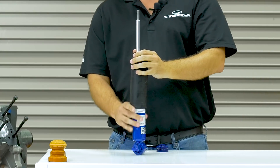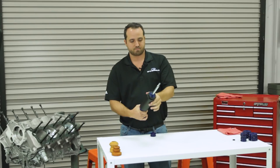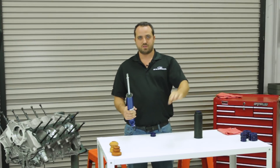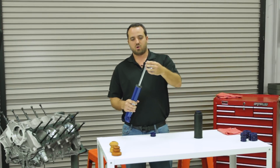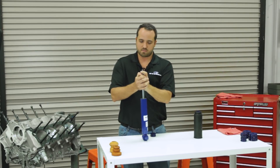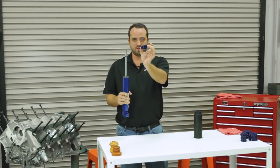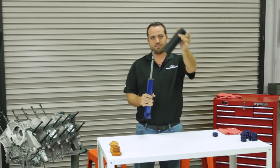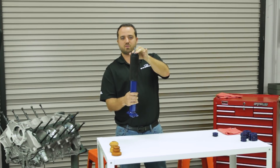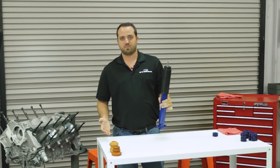Take the dust boot, drop it all the way down, and kind of walk it down on top of it — it pops on like that. Pull it back off. Now we're going on the assumption we're putting one of our Steeda Sport Progressive springs on today. So I'm just going to drop the o-ring on top of the shock right here, walk it down, and sit it a little below that. We're going to leave the second piece out because that's only for stock springs and minimum drop. Just drop this right on top, put your fingers on top, push it down a little bit until it's right here under the lip. Congratulations, you've now reassembled your shock.